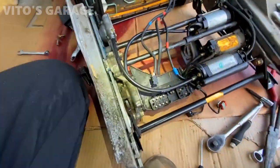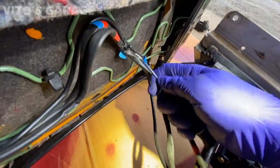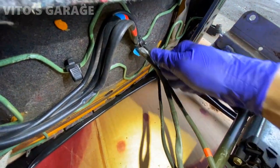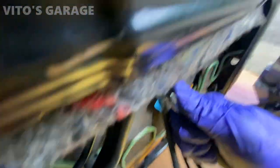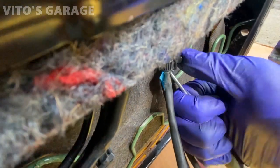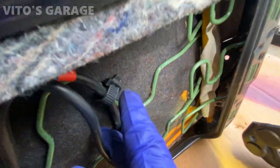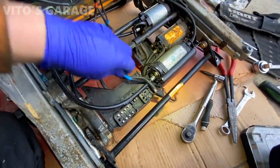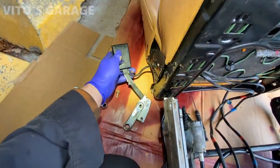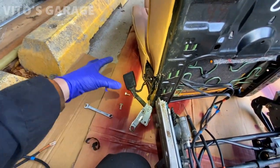This is all gonna get cleaned up. Now I'm just undoing this wiring harness and these factory zip ties. You don't have to cut them — just use a pick, slide it in there, put pressure on it, and just like that it's all intact and not broken — it releases from the factory like this. That frees up all these cables. Mainly you have to transfer the seat buckle — loosen it from this zip tie, take it out, and install it onto the new one.